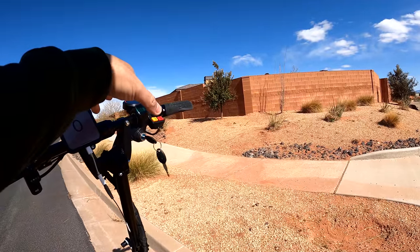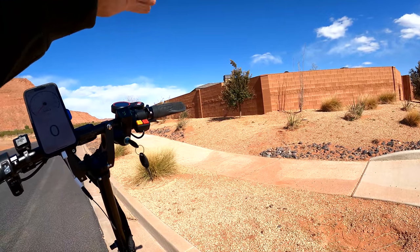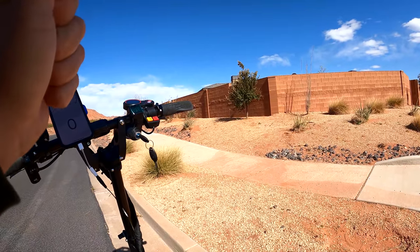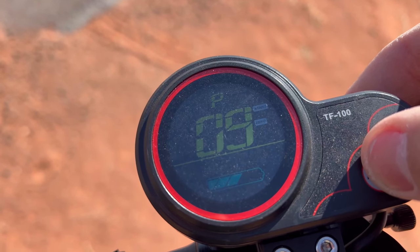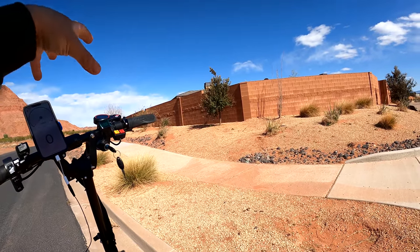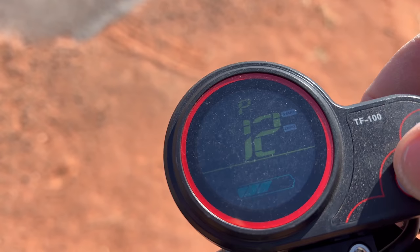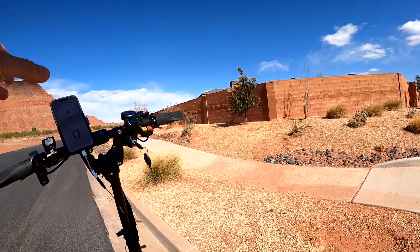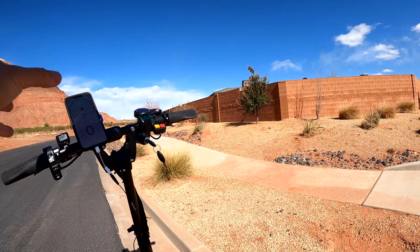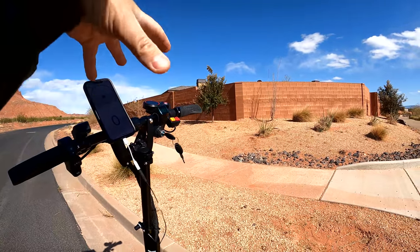I have about two and a quarter battery bars. On P level 9, you can change from a kick to a zero start. I do have it set to zero start for this test. On level 12, you can change from slow to fast acceleration — there are five levels. I'm first going to show how fast it takes off at level 0, which is the slow level, then run it again on level 5 to see if there's a difference.